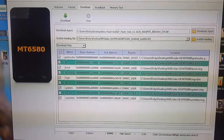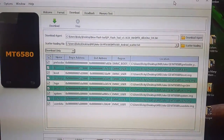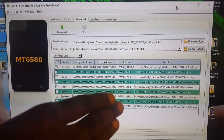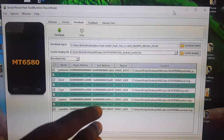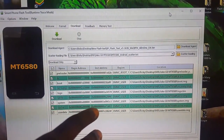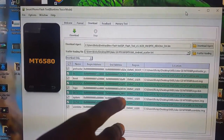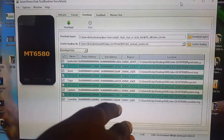After the first flashing, what's going to happen is that when you try to boot up the phone, you'll hear sound but you're not going to see anything on screen clearly — you'll see some lines running up and down. Don't panic, that's normal. Because there's no official firmware for this particular M8, what we're doing is loading a G8 firmware that's closely matching — it's not totally matching. So now we have to correct that problem. Now that you've flushed the first firmware and powered up, I want you to power off the phone again and remove the battery.